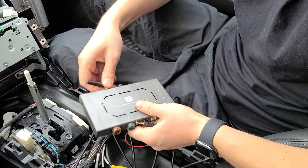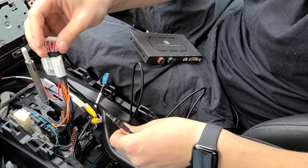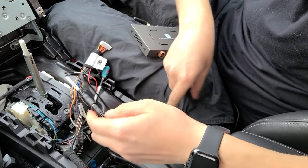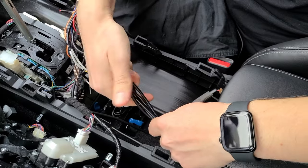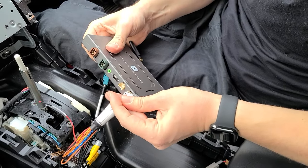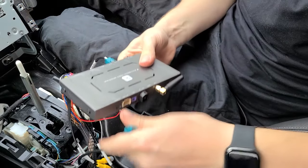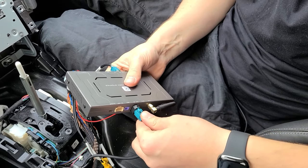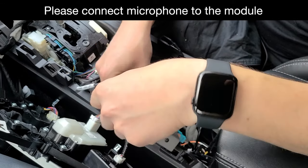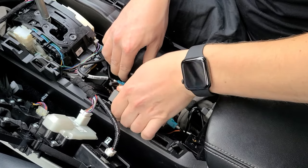Close the console and start connecting everything into our module. First, attach the WiFi antenna. Next, take the auxiliary wire — on the harness fed at the back, there's an audio out option where you plug it in, and you can use a cable tie to keep this wire neat. Take the end of the harness cable and plug it into the module. This is our video cable — plug it into the LCD out. The cable from the armrest goes to the USB portion. Rearrange the cables so they're not in the way, then tuck the module underneath.